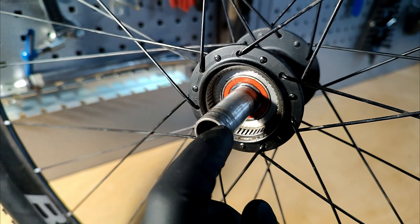Here we have the freehub stripped down — everything is clean: the sleeve between the freehub bearings, the axle and caps, the pawls, the springs, and the old bearings. Everything is clean and ready to fit the new bearings. The damage is visible but not to the point where the freehub will be unusable, so I'll continue with the service. The main hub shell is also cleaned out, bearing races are clean, and we're ready to press in the new bearings.